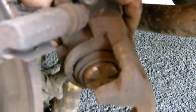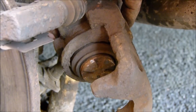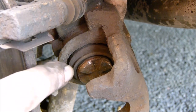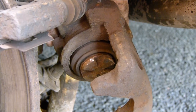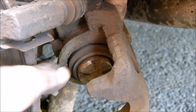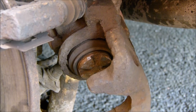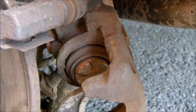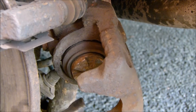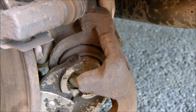Now it starts to get a bit more difficult. The thinner your brake pads get, the further this piston will come outwards, and to get the new brake pads back in you have to push this piston back inside. Normally it's quite an easy job - you could just use a big G-clamp to screw it back in. But unfortunately this type of piston has to screw in with a special tool. Why buy a special tool when there's a way around it? You'll probably only ever use it once or twice in your lifetime. All you need is some crocodile pliers, or in my case I'm just using some mole grips.